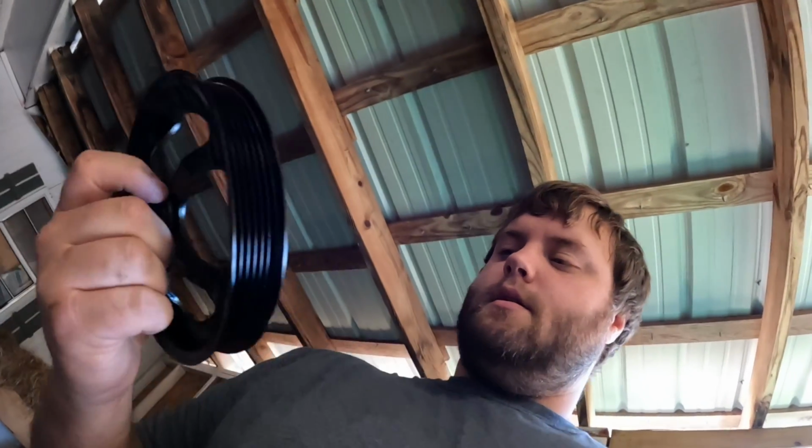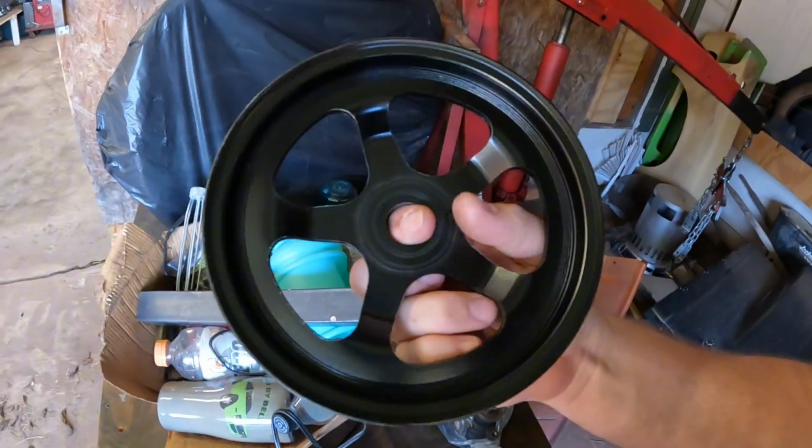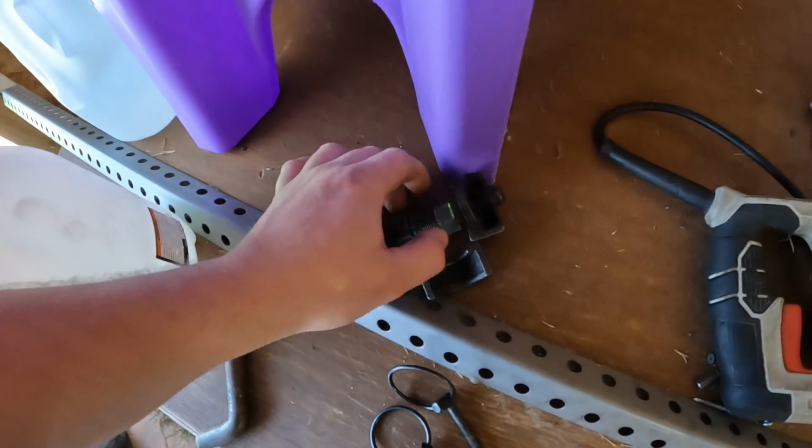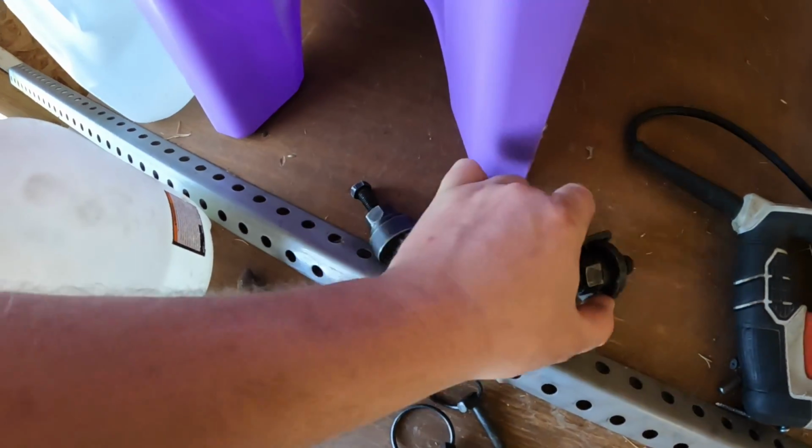But this time around, we're trying this Cardone metal pulley, and it's slotted, as you can see. So if I ever had to take the power steering pump off or that assembly area, I don't have to pull it off and mushroom it a whole bunch of times, because I lost my piece for the pulley part here, so I have to use a hose clamp to get it off, and it's kind of a pain in the butt. So we're gonna get this sucker pulled apart and put a new power steering pump in my car,